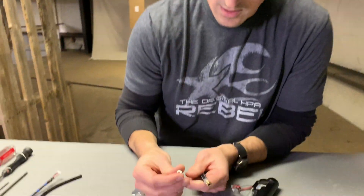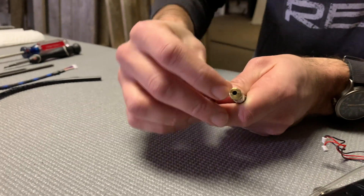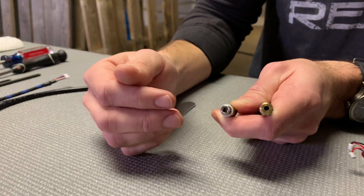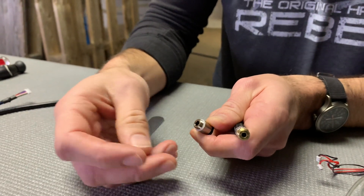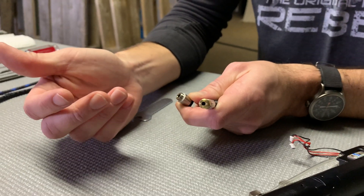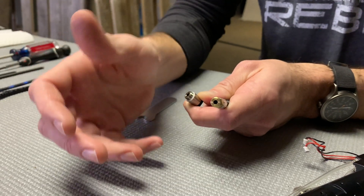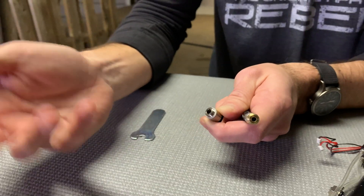Alright, so if you have an IGL and want to install that, it's going to seal a little bit differently. With the original input fitting, you've got the crush washer that seals against the shoulder on the fitting itself — we don't have that here, it's just the hex drive. So it can't use the same crush washer to seal against the cylinder. This will usually come with Teflon tape already pre-applied — usually black Teflon tape. There are some issues with that though: it doesn't always work the best, it can have a slight leak, and when threading it into the cylinder it can actually flake pieces of Teflon tape off into your system and cause leaks or further issues.